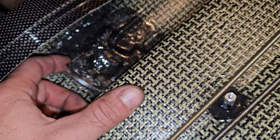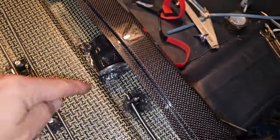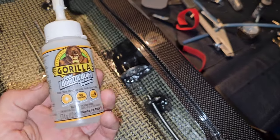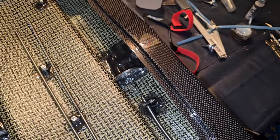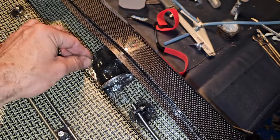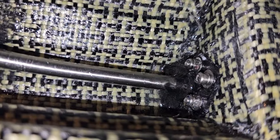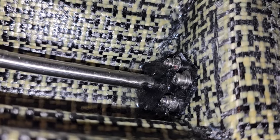I went around the edge — there was a piece that was actually lifted up, never really pushed down. Then I redid this side too. I first used 30-minute epoxy, let that dry, and then I used some gorilla glue, just poured it over top and took a small acid brush to spread it all over to make it a lot more rigid. Did the same thing for the stuffing tube mount, and then I noticed back here I was getting some grease coming through from the stuffing tube, so I went ahead and put some more epoxy there as well.